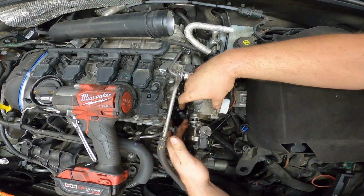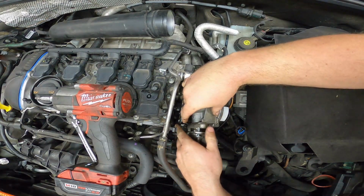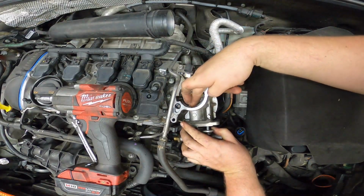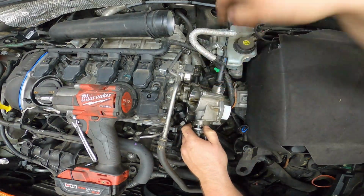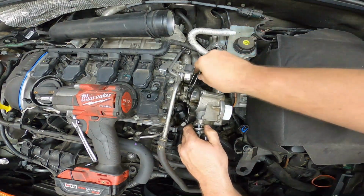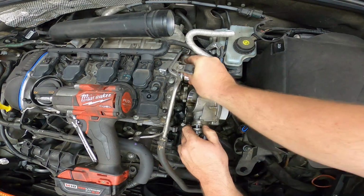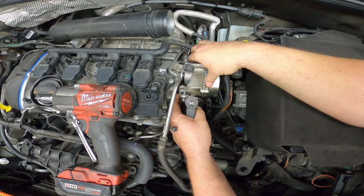Okay, so there we go. We've pulled the high pressure fuel pump assembly away from the vacuum assembly. And if we look down here, we can see that this is now smooth inside. So installation can go much smoother now. Go ahead and line up our gasket, knowing it's not going to stay the right way, but that's okay. We're just going to slide this over top.